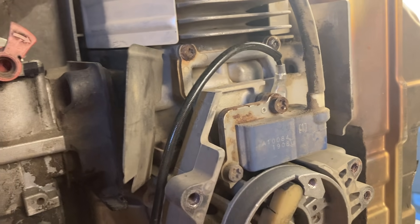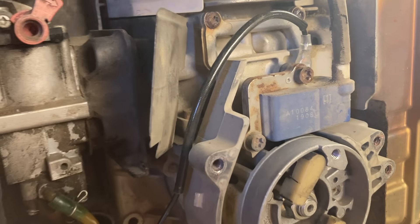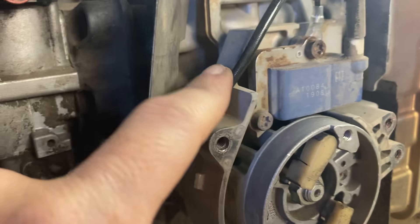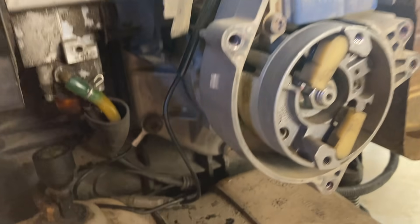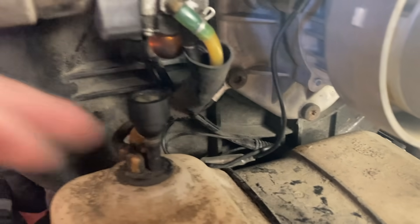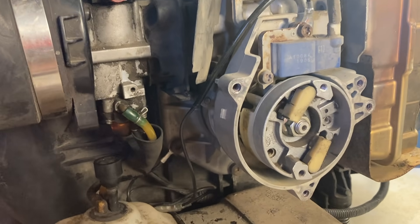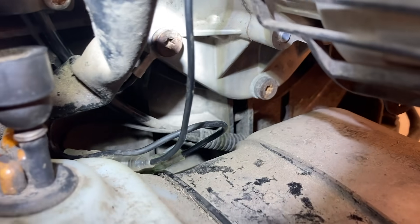Now, I'm not going to lie — I don't put it back the exact same way that I took it apart because I knew that caused an issue in the beginning. And so far, the ones I've changed, I haven't had back in the shop. The one that goes to the coil, I plug up there. And when I put this cover back on, I'm still going to stick it right where it goes through here, but I'm not going to put it back in this little channel right there — I'm just going to let it flow down here and connect. I'm not going to stick it back in this middle bracket. I'm just going to tuck them behind the gas tank. So I got both of them connected, just tucked on back here. Nothing's going to mess with them. There will be vibration, but they've got plenty of room to move and aren't going to get pinched or pulled. It goes right through there, comes right out of its hole, just travels on down — don't have it in its little slot, just tuck behind there. It works.